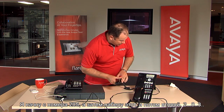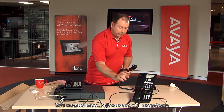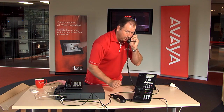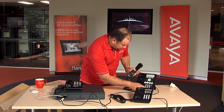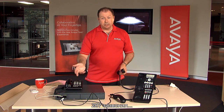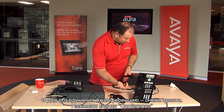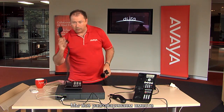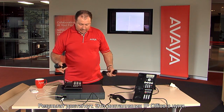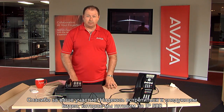Coming from extension 205, I'm going to dial this phone first and then dial the other one. Dial 203 — answer that phone, put the speaker on. Now I'm going to place that call on hold and dial extension 207. 207 rings — it's working. And to do a conference call, simple as this: press the conference key and we're all talking together. So there you have it folks — that's installing an IP500 from scratch. Simple as that. Thanks for your time. Look forward to seeing you on the next video we do for IP500.